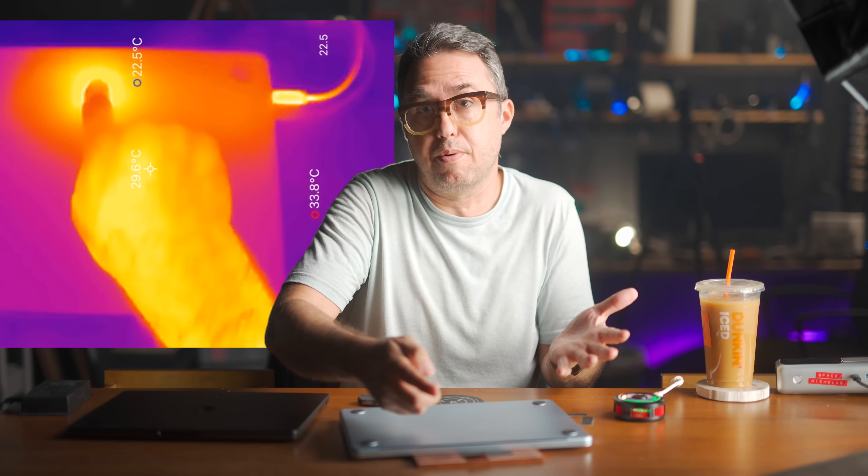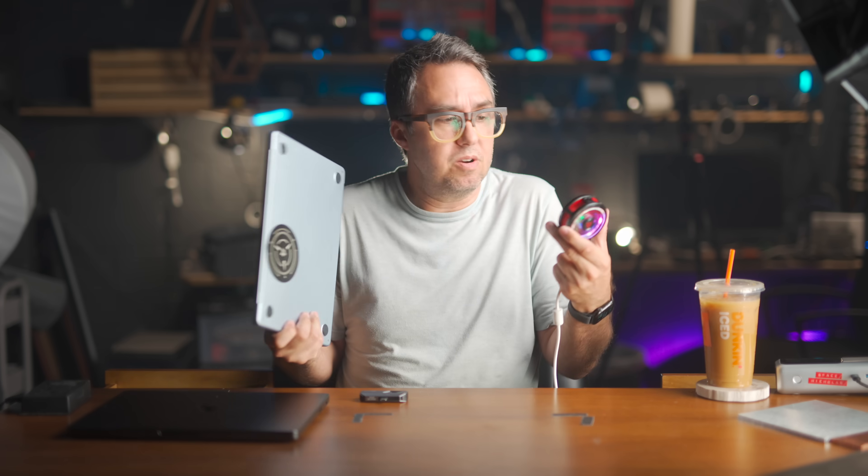Enter the Peltier cooling device. This one's designed with a magnetic surface. With the help of my thermal camera attachment, I was able to pinpoint the exact spot on the back of my MacBook Air that heats up the most — where the processor is — and then slap a little magnetic circle on the bottom of the MacBook Air, allowing me to pull heat directly off the processor through the thermal electric device via the thermal pad bridge. This thing is super clean and just clicks onto the back of the MacBook. And for all the comments about thermal pads heating up the battery — with this installed, the laptop battery is actually going to end up cooler than with the default configuration, because the heat now has a direct pathway straight out of the processor and into the air in this room.